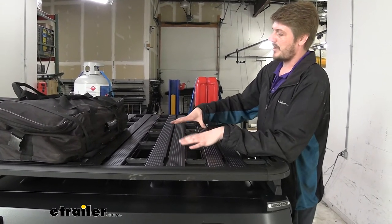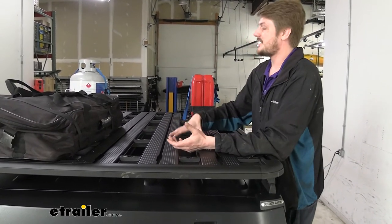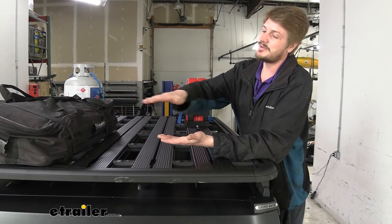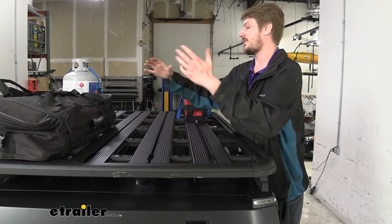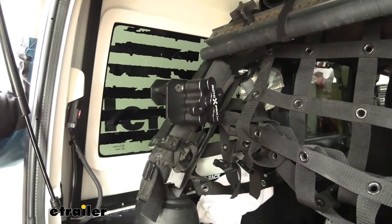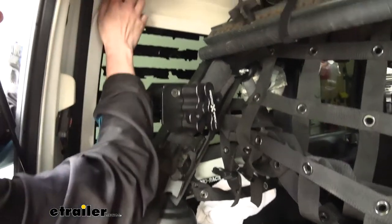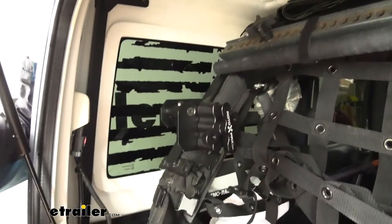You do want to keep in mind that when loading up your roof rack, if you do off-roading, it does decrease the carrying capacity due to all the dips and hard hits going off-road. The road's not as smooth, so you're going to have a lot more impacts that transfer up to the roof rack, dropping the capacity down to 176 pounds. It's able to achieve those weights due to the interior bracing on the backbone system, which provides reinforcement running down inside the hardtop to ensure it can support all that extra weight.